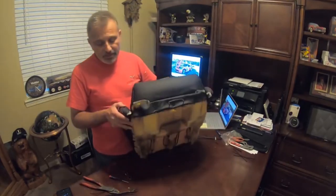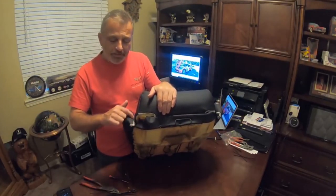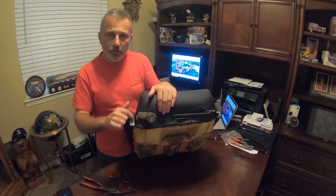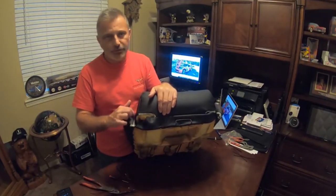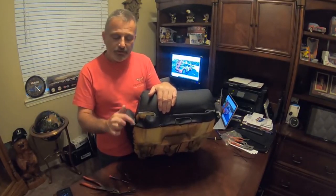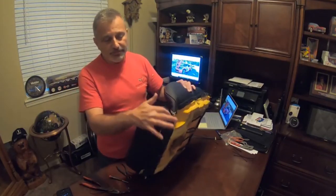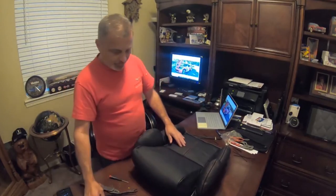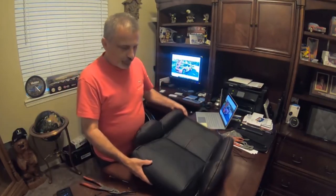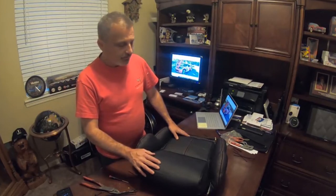Now what you're going to see is that they used white stitching along these edges. So this little section right here and here, that is going to be visible when the seat goes in. So what you want to do is use shoe polish, or you could use a Sharpie pen, which is what I use, and Sharpie this in so this is all black. And then at that point, no one's going to be able to see it. Same thing over on this side here. At this point, we are ready to put it back into the car. So I just wanted to show you the finished product here. We're going to go out, put this in the car, and then we should be good to go. So thank you for watching.